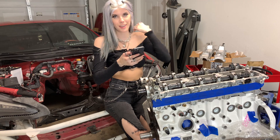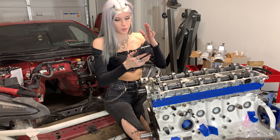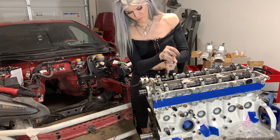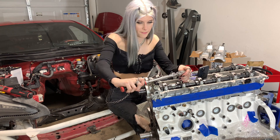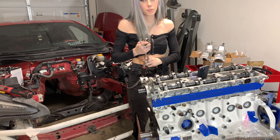And it wants me to spin them again. It says to turn the camshaft another further one third of a revolution - so that's another 120 degrees from where they are right now. Here we go with the locking pliers again. Loosen eight more bearing caps and then retighten in several passes back down to 15 foot pounds again.